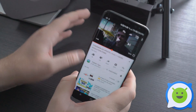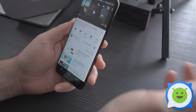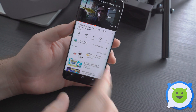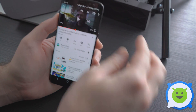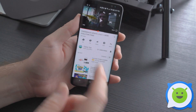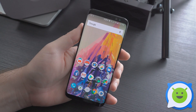A good way to fix this is by keeping the speakers as close to the device as possible — relatively within the same room. If you try to move one too far, maybe into the bathroom, and have multi-room audio streaming through both, you're going to have a lot more latency and you'll notice the audio timing goes off. By keeping one in the dining room and one in the living room, relatively close to the streaming device itself, you'll be able to reduce some of that latency.